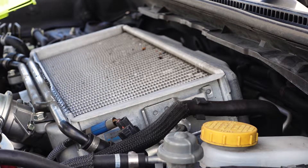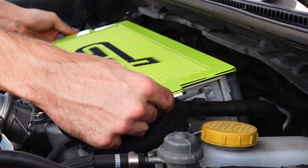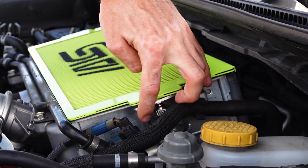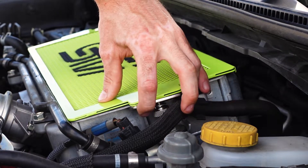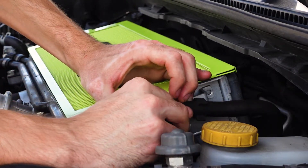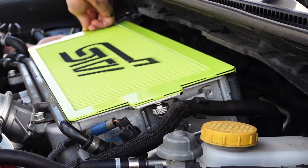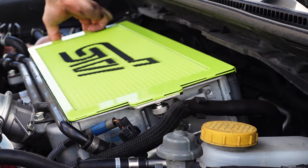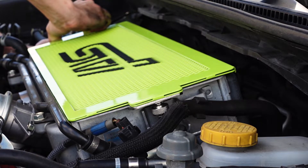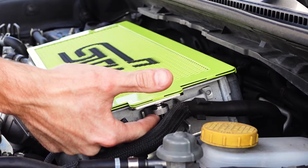Make sure the letters are facing the correct position, pull these metal plates back as far as they'll go, and you can sit this on your intercooler. Now you can see that this metal plate can go underneath the intercooler just like so. We're going to take and tighten down this threaded washer. Do the same thing on the other side — lower that threaded washer down enough to get the metal plate underneath the intercooler, then tighten it back up. After that, take a 10 millimeter wrench and tighten up the bolt on the bottom.